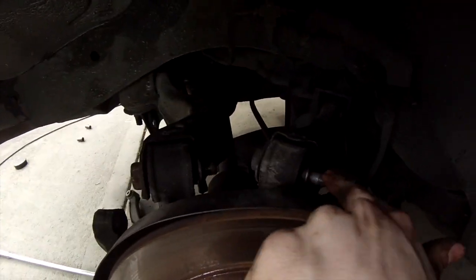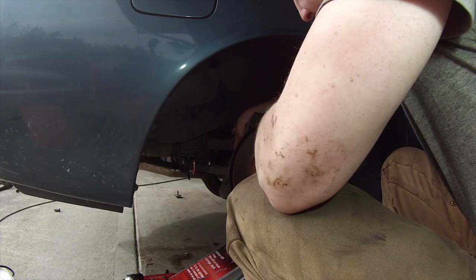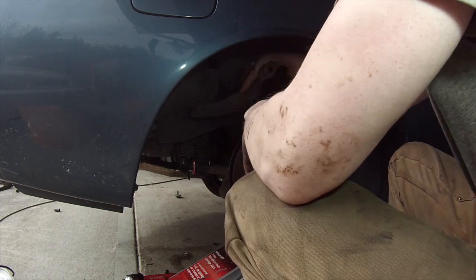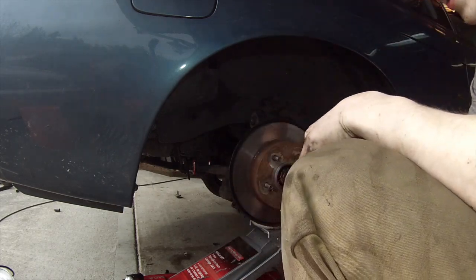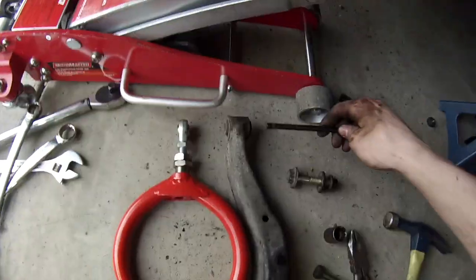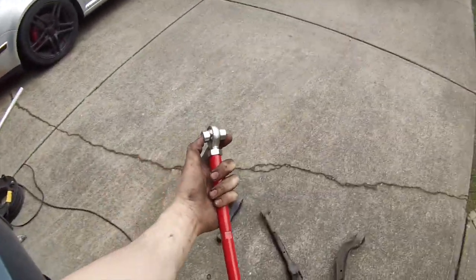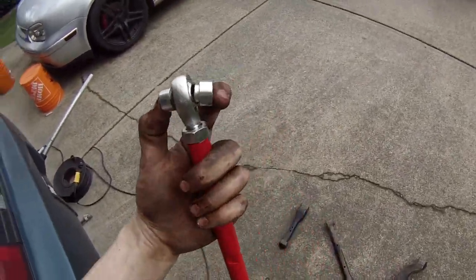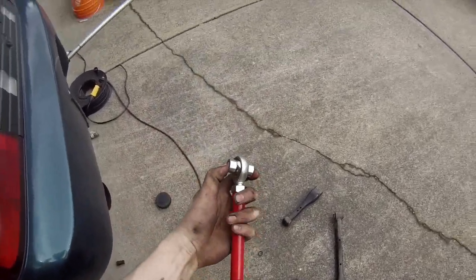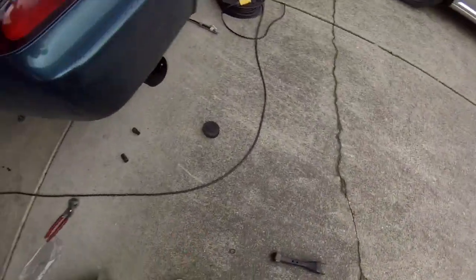Also, if you ever do this, you can't get this bolt out without having the rear upper control arm out of the way, so you have to do this after that. Alright so I'm going to take you guys back in time to when I was really confused about these toe arms here, but it's fine — you can see the width here and I'll talk about it from before.